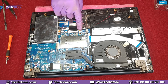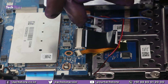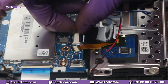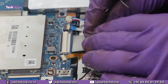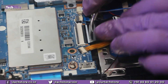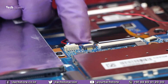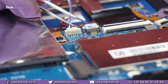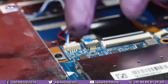This is the keyboard connector and this is the backlit keyboard connector. If your keyboard is behaving erratically and you need to use an external keyboard, just remove this strip connector and the keyboard connector. You can then use the laptop without the internal keyboard. Same applies for the backlit connector. This is the touchpad connecting cable — if the touchpad is not working and you want to disable it, just remove this connector and the touchpad will stop working. In another video we will show you how to replace the keyboard and touchpad assembly completely.